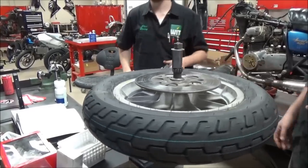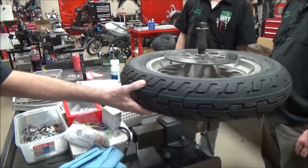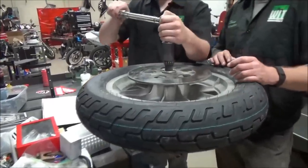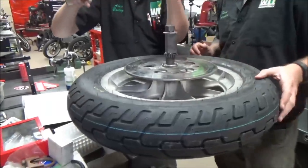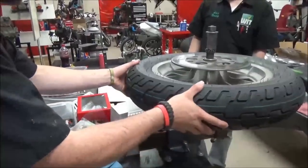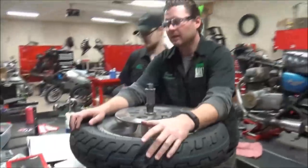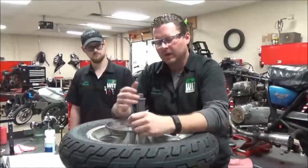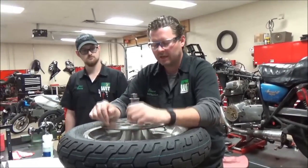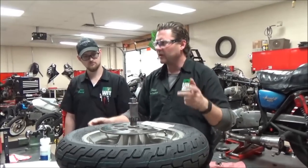Okay, 10 pounds — feel it now. You can definitely feel it wants to grab. Did you hear the wrench even click? No. So let's back it off. Now do that again — just one hand. Could you do it with one finger? Here's the thing: as you install wheels with the chain and brakes on, that drag makes it hard — the wheel isn't just spinning as free as it can be.